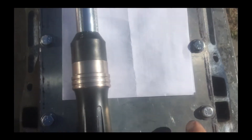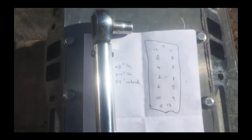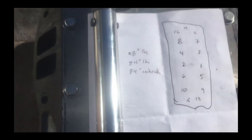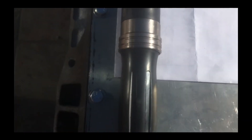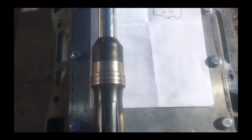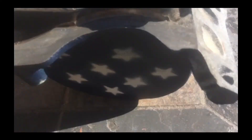One tip: you could mark the bolt numbers next to each hole and follow that sequence. The bolts are 7/16ths — or 11 millimeters, which is just a tad bigger than 7/16ths. The procedure is 48 inch-pounds first, then 84 inch-pounds, then recheck at 84. On the recheck they did need about a quarter-turn to come back to 84 inch-pounds. On the third recheck they were already at 84 — as you compress the gasket it loses a little, but it's in.